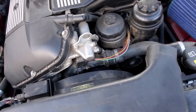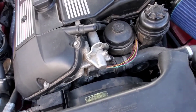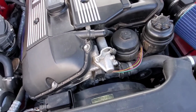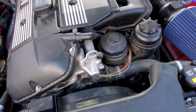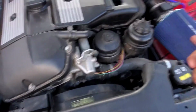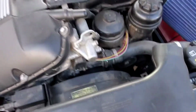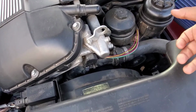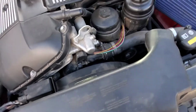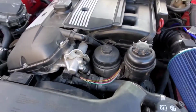And there's not really big electronics. When it rains and I'm driving, there's going to be water coming up into the engine. So I was like, there's not really any wire exposed, I should be fine. And I just dumped a whole bunch of water on it. I don't recommend just going all out with water. All I did was get a cup, and I just started spilling it onto the belt. And like I said, it worked. And that's how I know it was my belt, not my pulley.